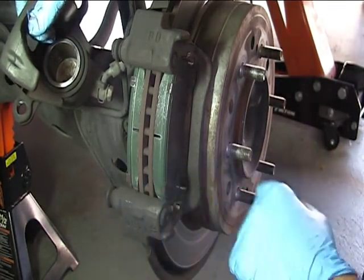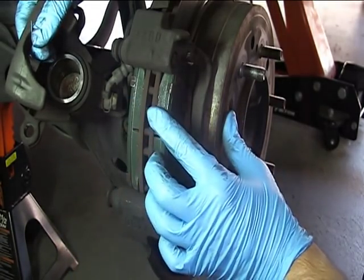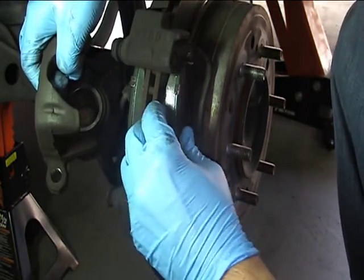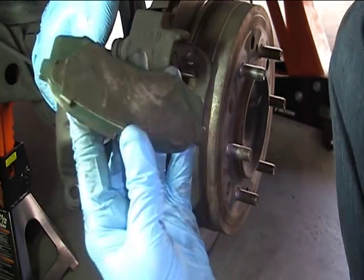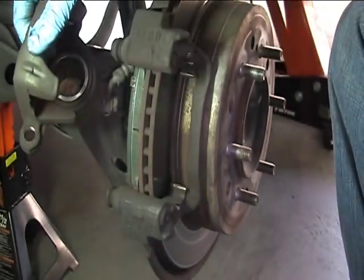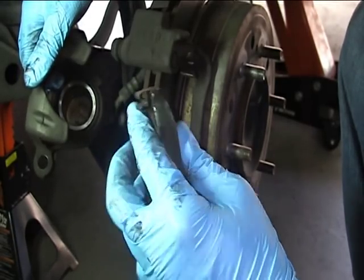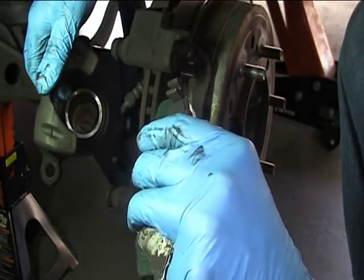You can probably tie it up with some zip ties if needed. These brake pads are new so we've already replaced them, but they're pretty simple to get in and out. Basically you'll want to pull back and pry with a screwdriver a little bit to slide them back, and they come out at an angle. There's a clip on the backside — clean that up and stick it back on the new brake pads. The other side literally slides straight out. The key is you have that same shim to put back on, and then you have the actual brake low indicator clip, so make sure you replace that and put it back on the brake pad before you reinstall it.